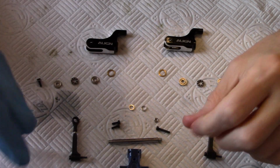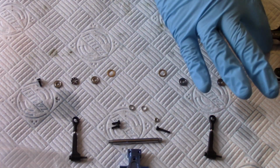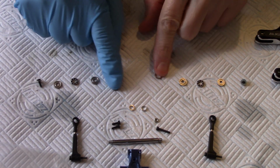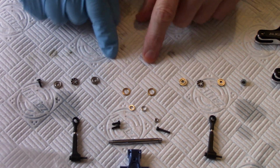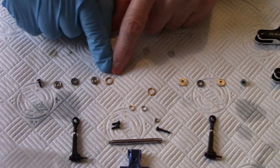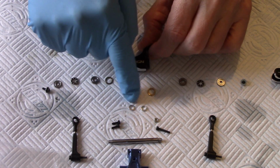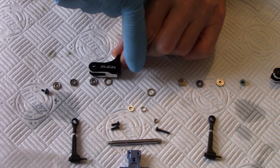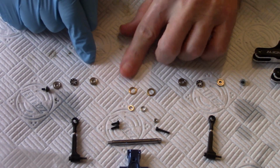And we're back. So we've put the bearings in here, so I'll just move them out the road to the side a minute. Now the actual thrust bearings, we'll move these two little copper spacers up a little bit, just so they don't get mixed up, because all this is part of your thrust bearing and they go on the inside of this, and them two little washers there go on that side, the outside. But just move that to one side for a moment.